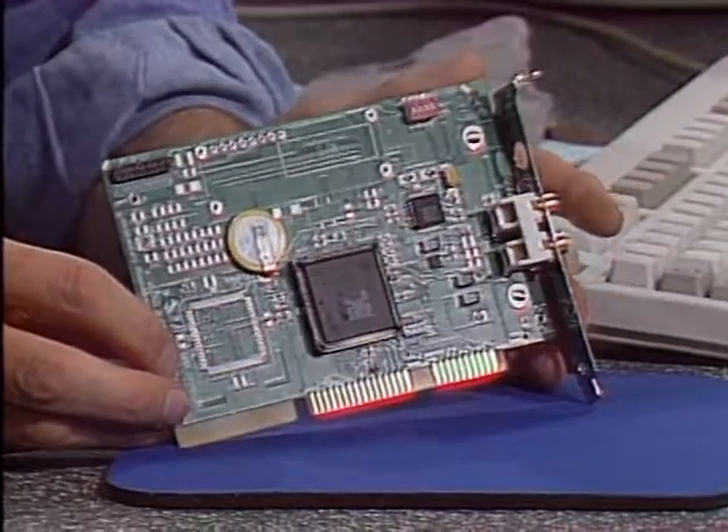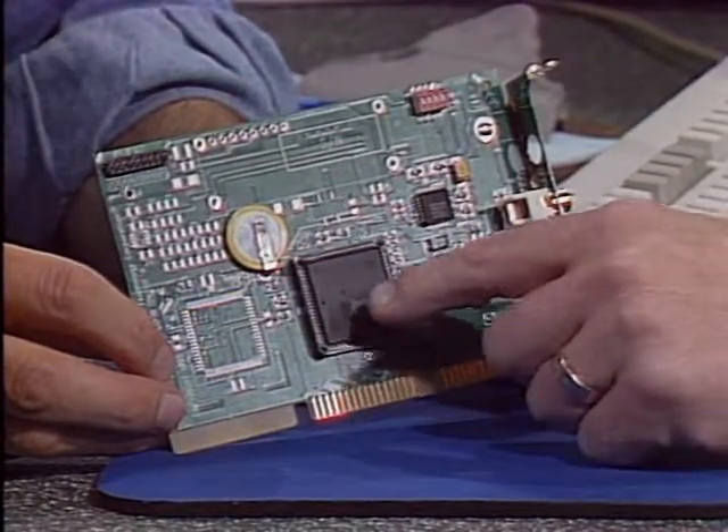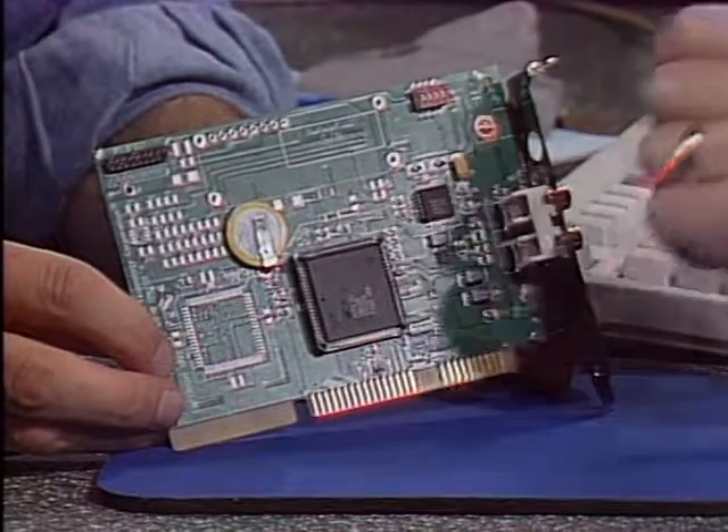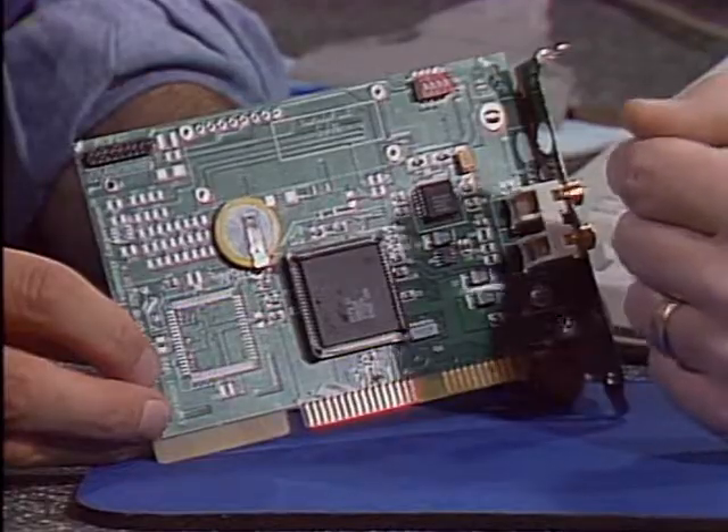This is the gadget — basically it's just an ISA board that you slip into a PC slot. It goes right into your PC and is made up of just two chips. It also has a way to deliver video in and video out. So it's like a normal modem card, except instead of a phone line going in, it's a TV signal. This particular one doesn't have a tuner, but it could have a tuner on board, in which case a regular RF signal could go right to the back of it.